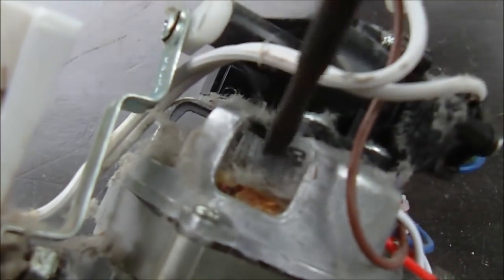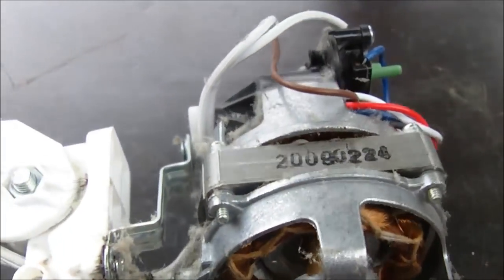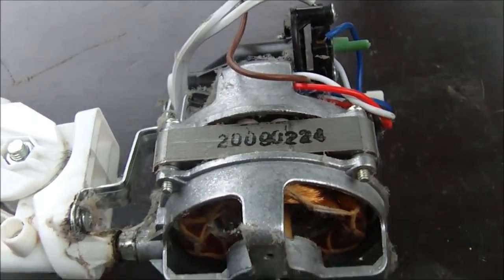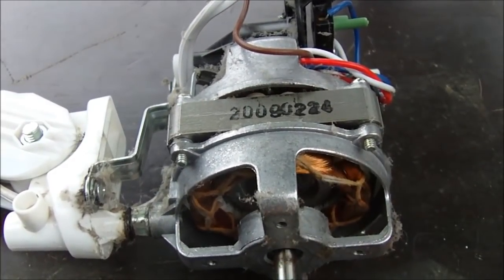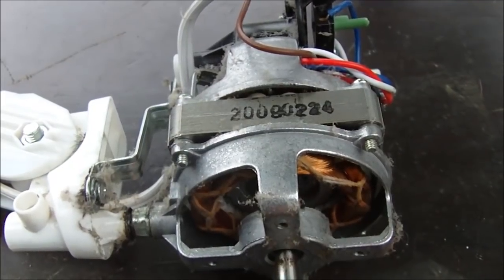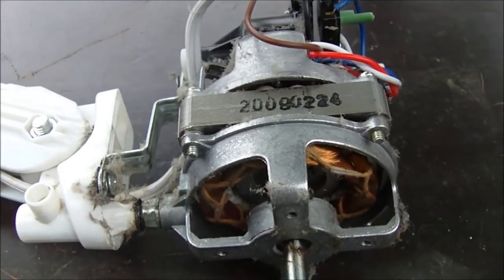You can see in here there's a bearing back there, so you need to get the oil in there. To take this whole thing apart you have to take these screws out, pull off the cover, pull the rotor out, lubricate the bearing in the back and the bearing in the front, and then the motor will work again — but that's only if the motor is actually functioning. You can sort of feel it trying to work, but it's stuck. With this motor, that's not the problem.